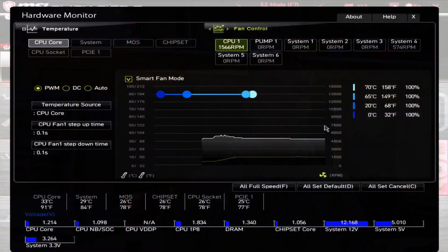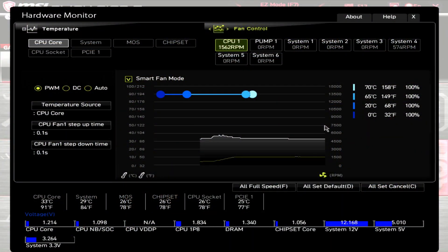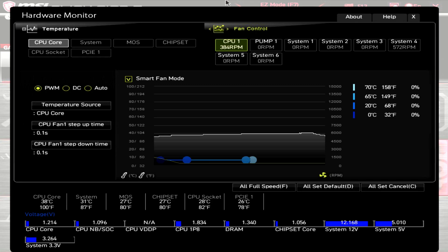That's the installation. Next, I'll go over the fan's PWM range. With the fan attached to the heatsink at 100% PWM, this motherboard is showing the RPM of this fan at around 1570, with the dBA being 36.4, taken from 20 inches away on an open-air test bench. Dropping the PWM down to 0, the motherboard is showing the RPM at around 380, and the dBA is at or below my noise floor of 32. So all in all, this fan does have a pretty good RPM range.